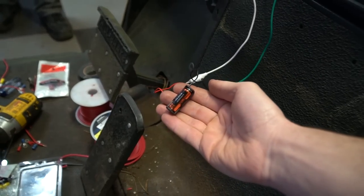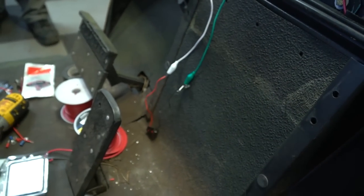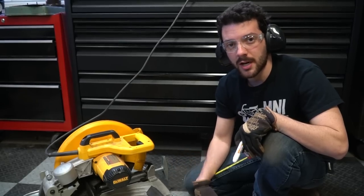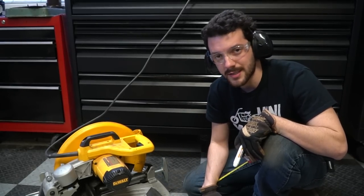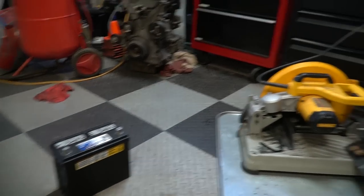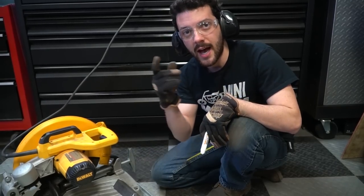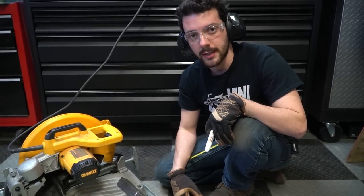Not enough battery — this is the 12 volt test battery we're using, so it's no wonder we don't have enough. I'm making a battery box for the golf cart. The 420 does not have a charging system, so we're going to use a good old Honda Civic battery. I'm going to use two five inch pieces and two nine-and-a-quarter inch pieces welded together and welded into the chassis. Ike is running throttle linkage.